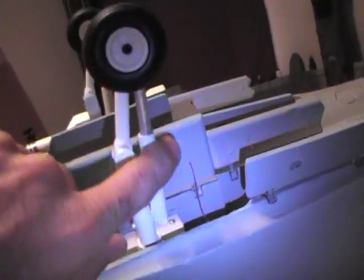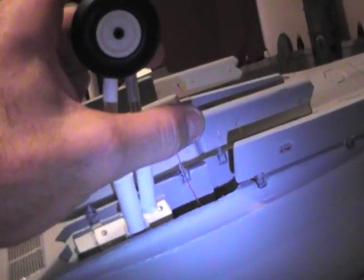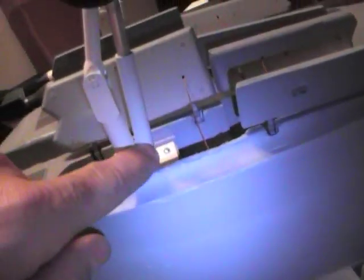This guy right here, the strut in the back, is just held on with two C-clips. You can actually take those off and separate this from it. And then there's a cap right there. That's why I had mine boogered up. You saw some chew marks on it, because this is all aluminum right here. These little caps, I think they're plastic, these pins. But you can pull this off and change your springs, and the C-clip is back on. Real easy to do to beef up this springing action right here.